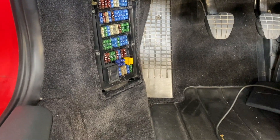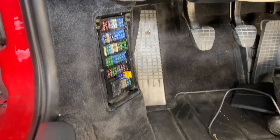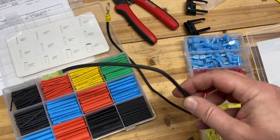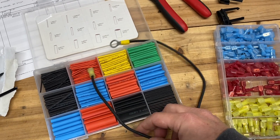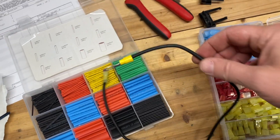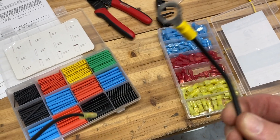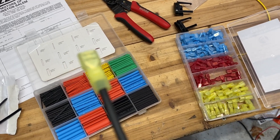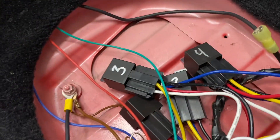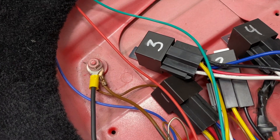I just popped the carpeted fuse panel trim piece back on and put the four screws in — how clean and nice does that look? With the scraps of big wire left from running power to the seats, I put a spade connector on the front and a ring terminal on the other side. I'm going to mount this to the bottom of the seat for the ground and hook the other end directly into the connector of the seat. Both sides of the floor have a 10mm nut — loosen it, slip the ring terminal under, and tighten it back.